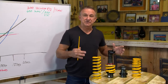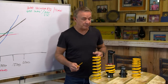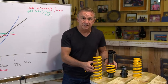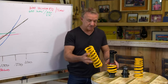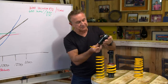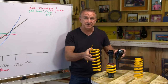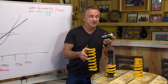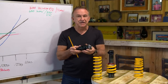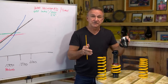Now, what have they been doing in previous years? They've been giving teams like Triple Eight a pretty big advantage because they were pretty smart with it. The dual spring setup — now this was in the rear of the car. It is exactly what it says: dual spring, two springs. You have two linear springs stacked on top of each other with a cool little slider device that slides up and down, takes a bit of the load, and makes the progression of the springs very smooth. Initially this was a bit of an issue because they used to stick and seize, but once teams got their head around it, with little bearings in there, the operation became a lot smoother.